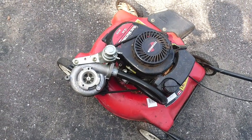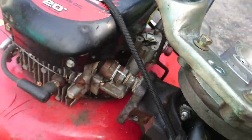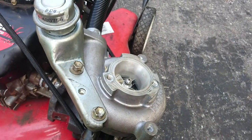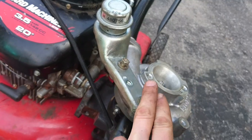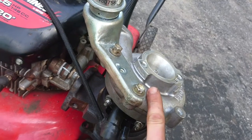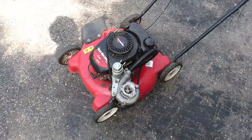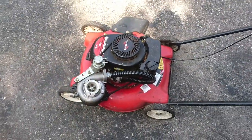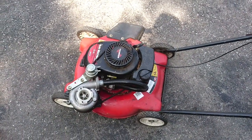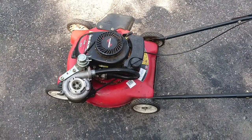It did run for about a second but not very long — main reason being probably a major exhaust leak from the flange setup. The goal was to make it work, and although we didn't build any boost, the turbocharger did spin and it was mounted for a few seconds. I'm still going to upload it even though it was a bit of a failure — hopefully you guys will enjoy watching it. As always, thanks for watching. Please subscribe and let me know if you want to see more — I can probably upgrade it. Like, comment, and subscribe!